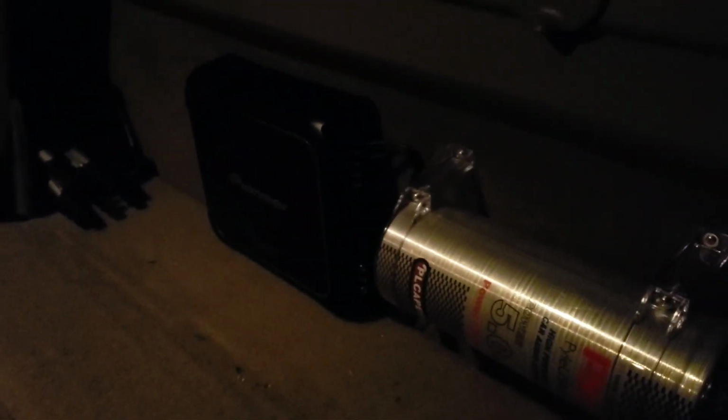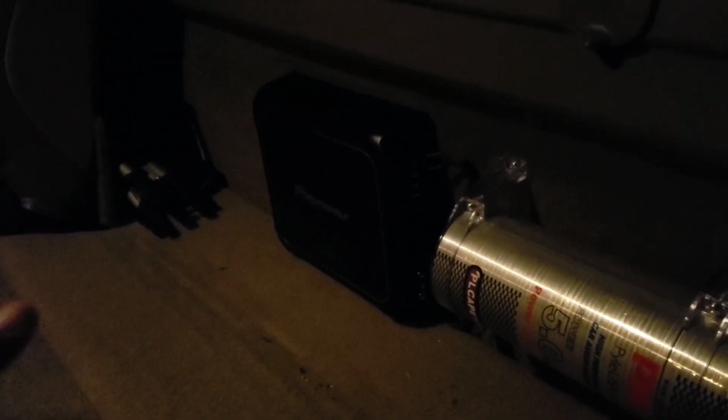So you guys ready to see this setup? Here it is. As of right now, I only have one working, but you get the gist of what's going on. This is a Type S in there. Here's my setup for now. I get into my other amp, which is a pretty small amp for 1600 watts, but not obviously RMS. Right now it's wired up to 2 ohms, so it's making 500 watts RMS to 1 sub, and then it'll be the other one, so it'll be twice as loud tomorrow.